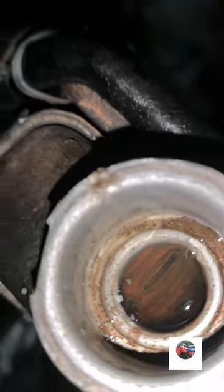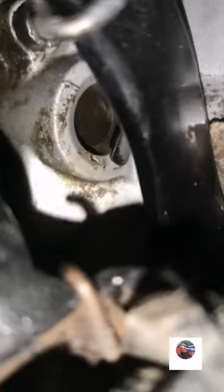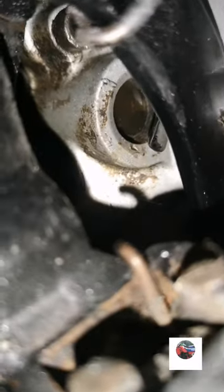It doesn't look milky. Let's check the radiator anyway. I haven't checked that yet. The coolant looks alright, looks like a pinky colour. As long as it's not milky and oily, that's good. So now the water pump seal in there is alright. Yeah, there's the oil, you can see better from that end. You can see through it a bit, so the oil might be alright anyway.